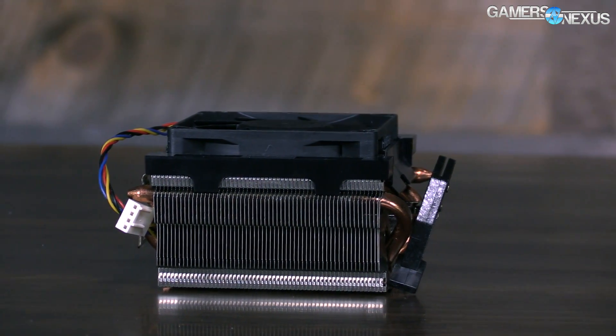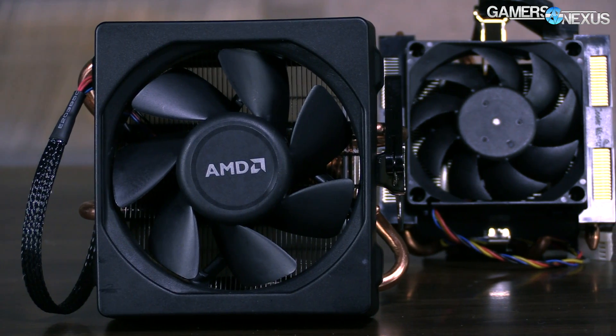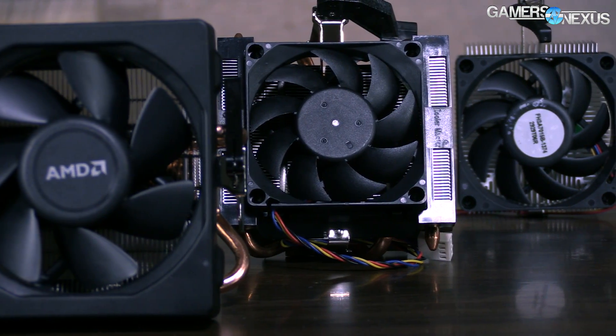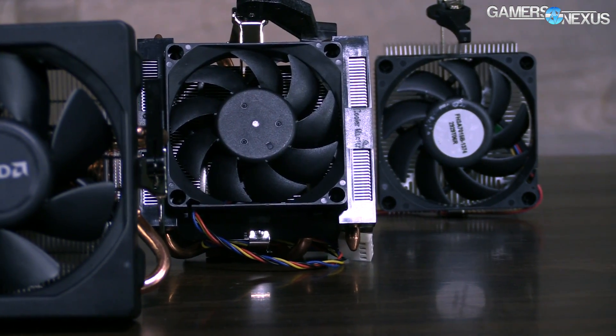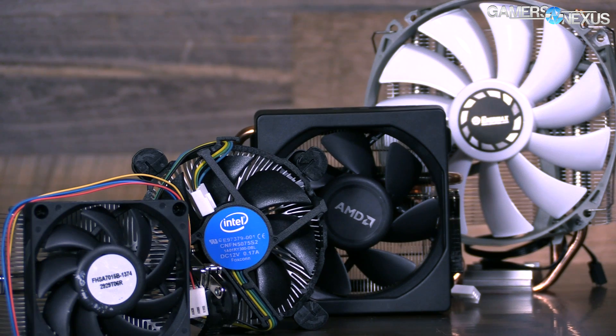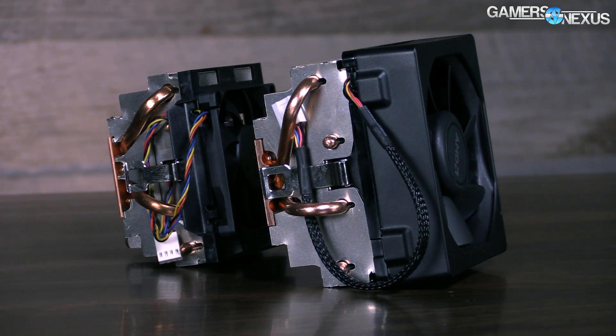Generally, AM3 Plus and FX — I'm not a huge proponent of recommending at this point because competing processors are so close. But if you are buying one, do get the Wraith model if you don't plan to use an aftermarket cooler, because it is substantially better than the old stock one. If you're buying an aftermarket cooler, buy the old CPU SKU and throw out the cooler. I hope to see AMD continue the Wraith with their next line as their CPUs hopefully become more relevant again. The white LED on the side is a nice touch. Thanks for watching.